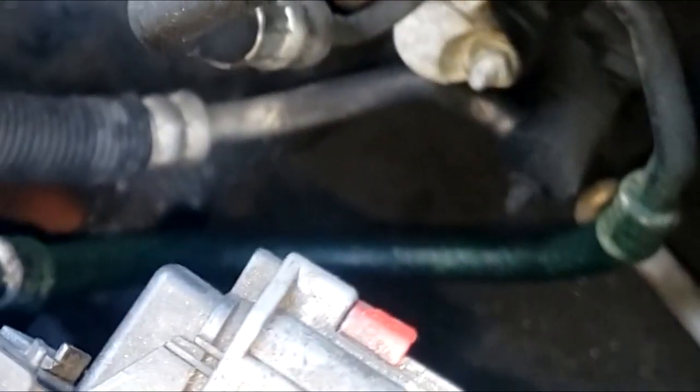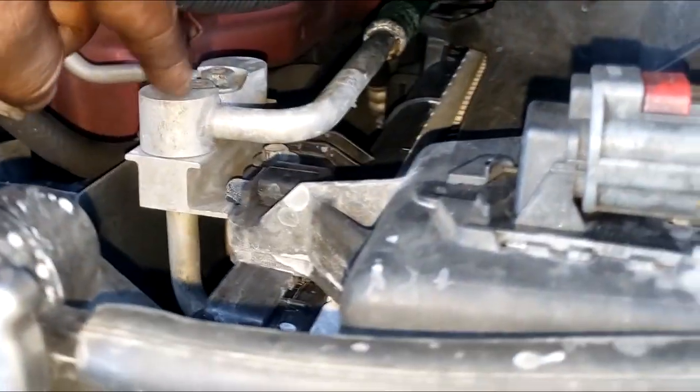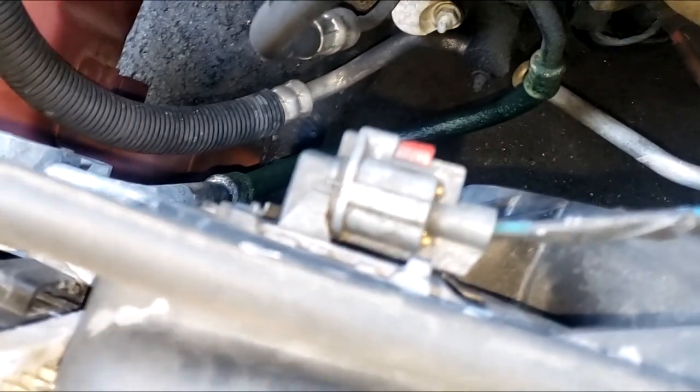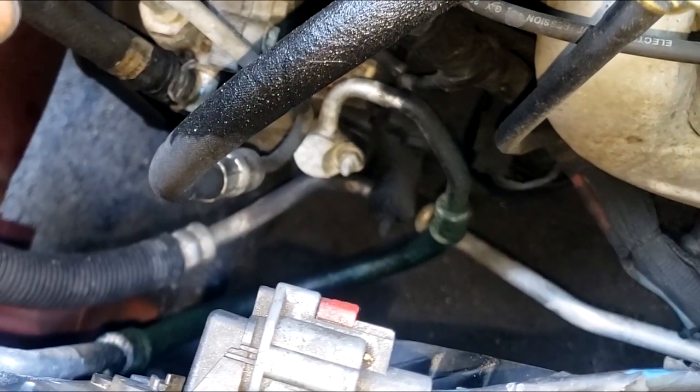Okay, pay attention to what's going on, okay? Because you are responsible for this AC repair, and you're also responsible for calling out the right part. Look at this line, guys. It's coming from the compressor. Where's it headed? Into the condenser, right? Which makes this a what? High pressure line? Liquid line? Can't be a liquid line, right? Compressor's not gonna spit out high pressure liquid, right? No.